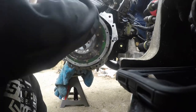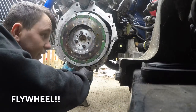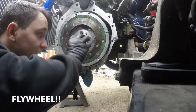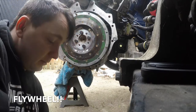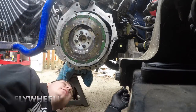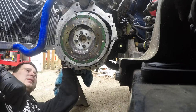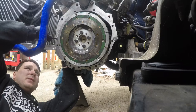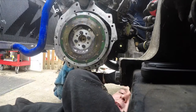Yesterday I showed you I had the old flywheel on with the adapter plate. The reason I had the old flywheel on is because I have to make a spacer for the new one so it will be centered and good to go. Taking it off right now so we can countersink some other holes. Got it. Every hole is done except for that one up there — still got to drill those out to make them bigger so I can put a bolt in, but we've got pretty much every one of them on the block bolted in.